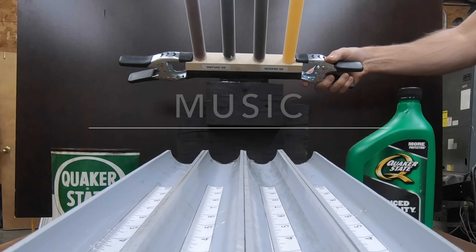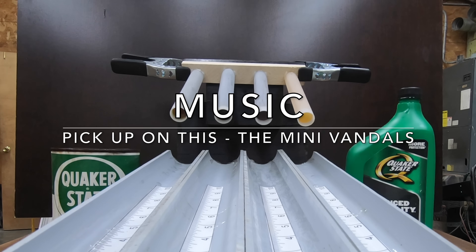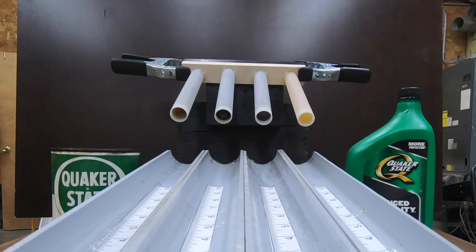When it comes to selecting a high quality motor oil, cold oil performance is a huge factor. The oil we're about to test has been inside a freezer for nearly 24 hours, set at minus 40 degrees Fahrenheit. Let's kick off the cold oil flow test. 1950s oil in lane one, cooked 1950s oil lane two, cooked Quaker State lane three, new Quaker State lane four.